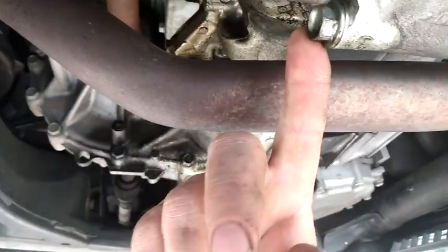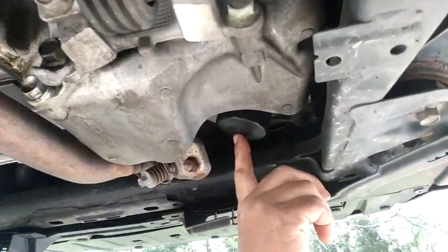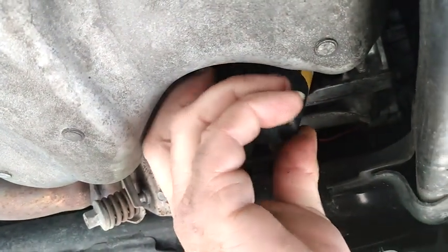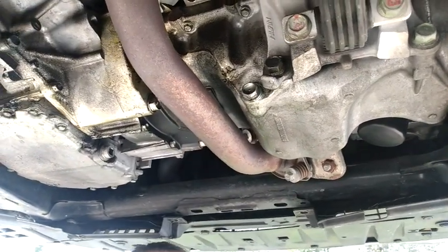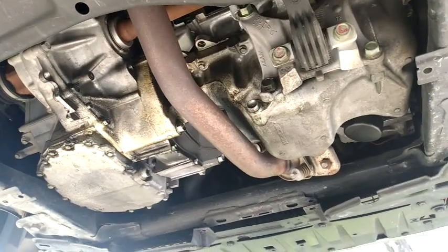A 17mm and a ratchet wrench is all that you need to change your oil and transmission fluid. Here we have the drain plug for the engine, and here we have the oil filter — you may need a special tool to get it off depending on how tight it is. I've already broken this loose; it was hand-tight. Somebody did a good job — they lubed the seal before they put it on. This is key for the next oil changer: it allows them to remove the filter without destroying it, and it also gives your car a good wet start if you fill the filter and lube the seal. We're going to drain these fluids out and we have a portable drain here.